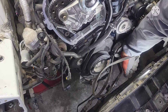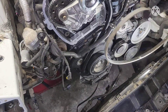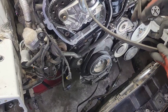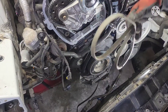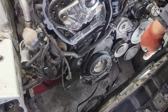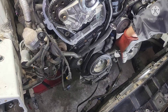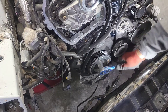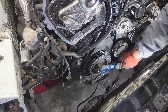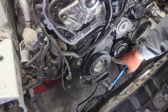Need to salvage some old parts to make things work — there you go guys, that's it. This belt trick works awesome; you don't need special tools at all. Alright, this is torqued to spec. Bringing it back to TDC — that blue marker here matched to my mark on my timing cover, at about 3 o'clock.